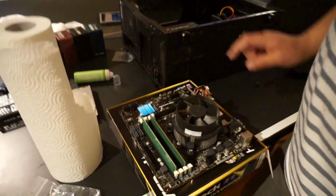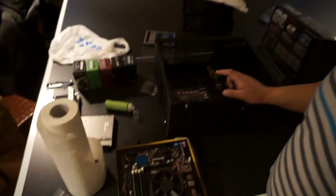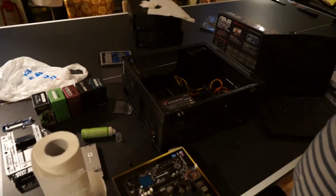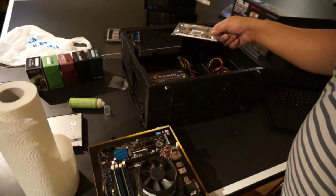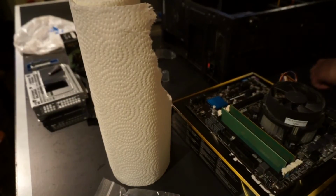Well, after you put together your CPU, your RAM, and your cooler, the next part is the case, which we will step into now. And make sure you put your I/O shield in. It's really annoying to get in afterwards, so pop this right in the corner over here, pop the CPU, sorry, the processor down, and you're on to the next step.